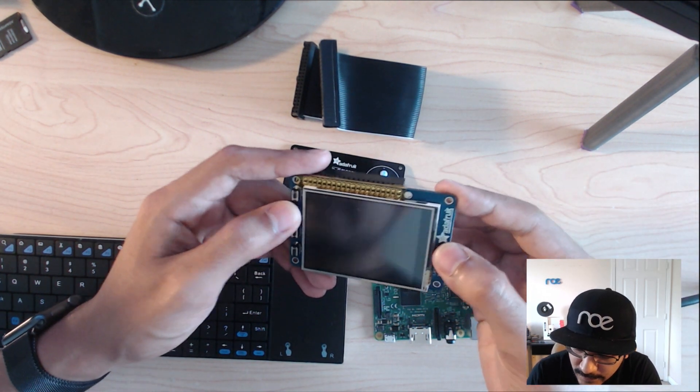Our SD card is finished burning. What I recommend doing first is plugging in HDMI to your HDMI monitor. I also have a USB keyboard with the USB dongle already plugged in. So all I have to do now is plug in the SD card and give it some power — I'm using a 5 volt power supply connected to my wall with a micro USB cable. It might take a minute to boot, especially on initial boot, but it'll boot up into RetroPie. It'll prompt me to set up the controls — every default installation of RetroPie will ask you to input your controls.